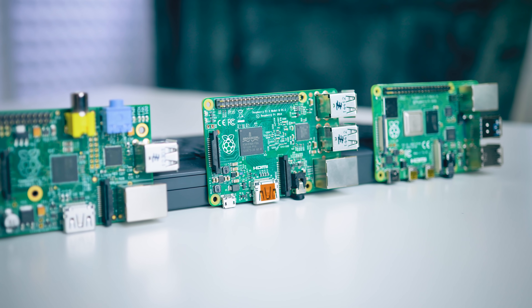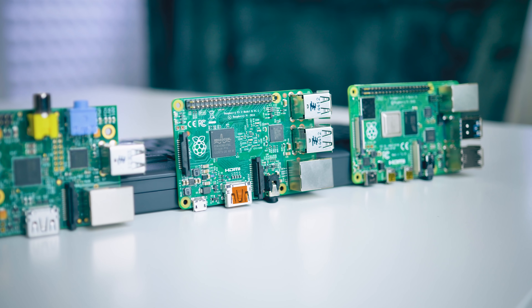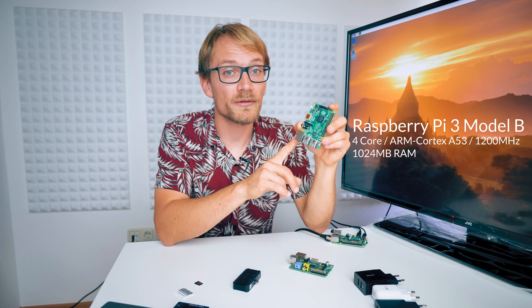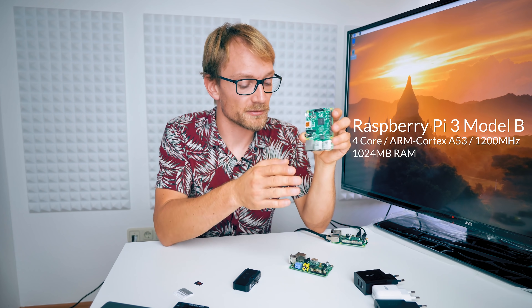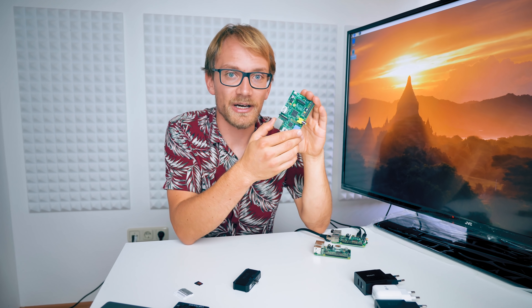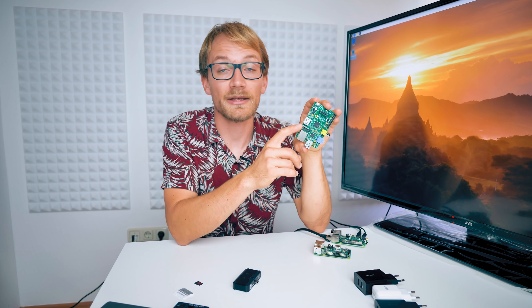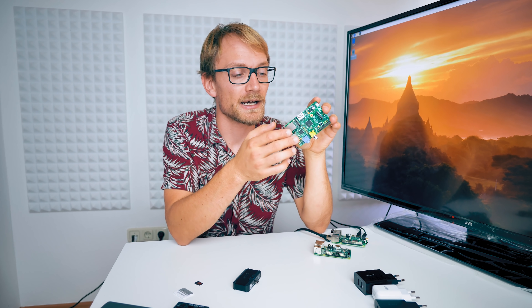This is the Raspberry Pi 3 Model B. It has four cores of the more modern ARM A53 architecture clocked at 1.2GHz, and the different architecture makes way more of a difference than any extra clock speed could make. Even if you overclock the Raspberry Pi 1 to a GHz, which is kind of the max, it's still really slow. That is actually the clock speed the Raspberry Pi Zero is running at — this is basically the same board in a different form factor, so you can take the benchmark results from the Pi 1 as a reference; it's slightly faster, but not by much.